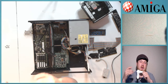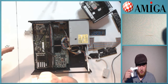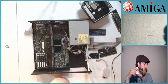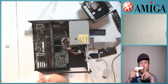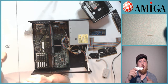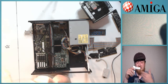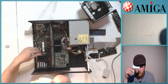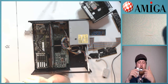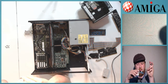The second mode functions as what they like to call standard joypad mode. So what that does is your D-pad works as normal. You have a regular fire button, but then you also, depending on your controller, on mine it's mapped to a particular button, get an additional map that is mapped for up on the joystick, which traditionally with these older kinds of games for the Amiga operating system is jump. A lot of these games have up to jump, and a lot of people will note that up to jump, even with modern stuff, old stuff, can be kind of annoying. So it's nice to have an additional map for a button to jump. So 2 blinks gives you that mode that is kind of the standard joypad mode, if you will.